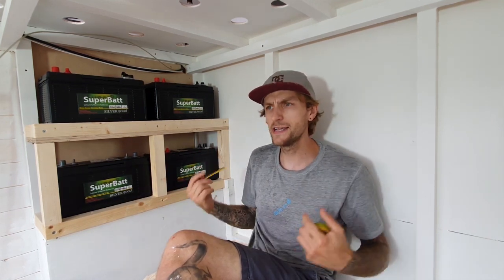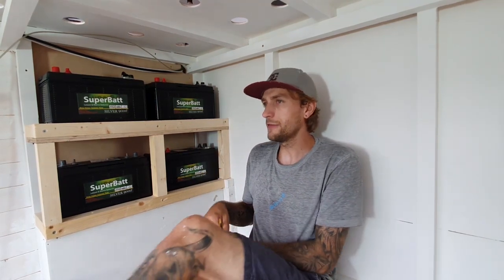The next thing to consider is amp hours. Working out what size battery you need in amp hours can be a minefield. It depends on what the batteries are powering and how long you want to be off-grid for. The first thing to do is work out the power consumption of all your equipment in your van. Each piece of equipment will have a kilowatt rating — a power consumption rating — always in wattage, or occasionally in amps. You divide the watts by the system voltage, which in this case is 12 volts. For example, 30 watts divided by 12 is 2.5 amps. You convert all your power consuming equipment from watts to amps.